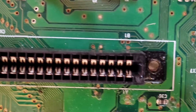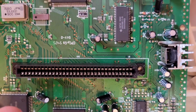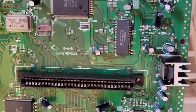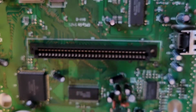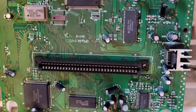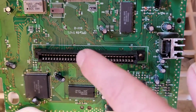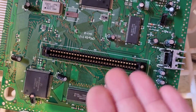Yeah, that was wild. Not exactly sure where that was, but obviously I pulled it from wherever, because I just went one motion constantly. I was cleaning it up, and it all got pushed over here. That big wad of lint or string, whatever that is, that was in there. Okay, we're going to let this dry. We'll take care of the shell. Put it all back together. I may make some adjustments to these pins here. Make them a little tighter. You don't normally have to do that with a Sega Genesis, but I may want to adjust these a little bit.